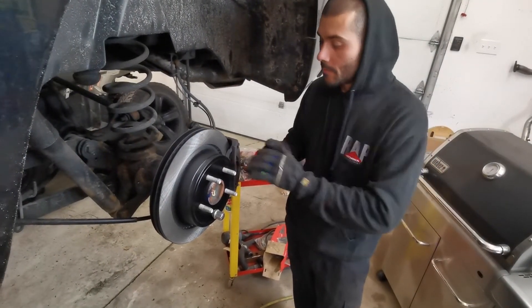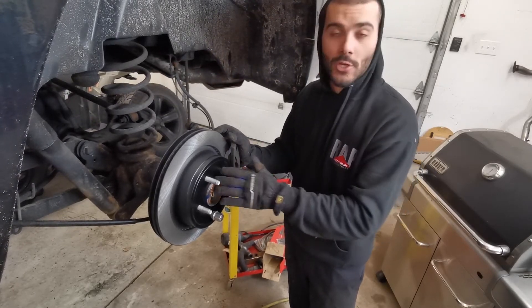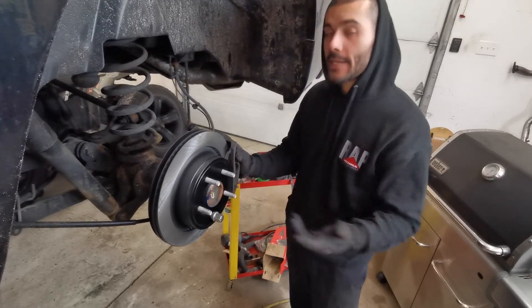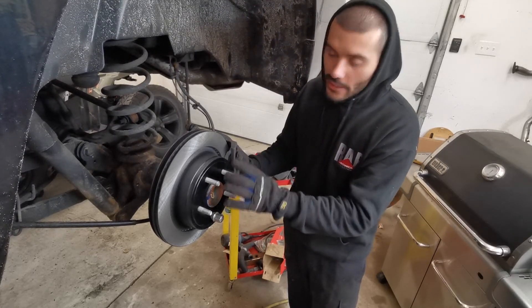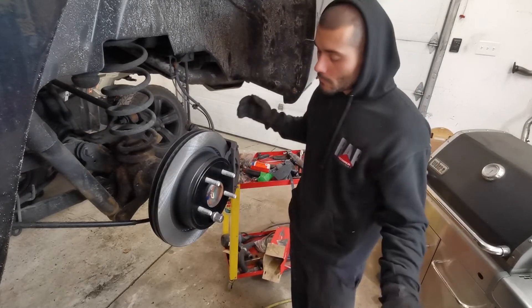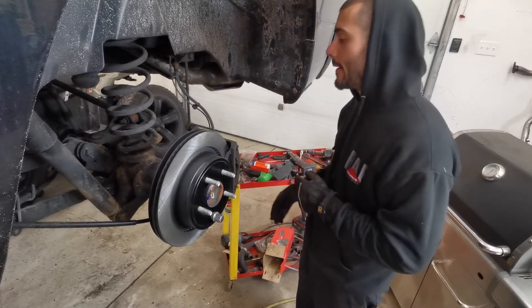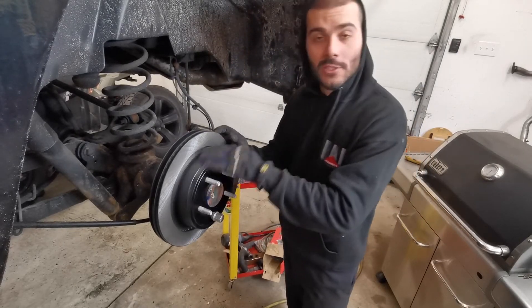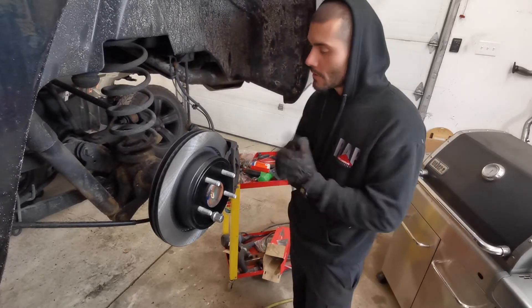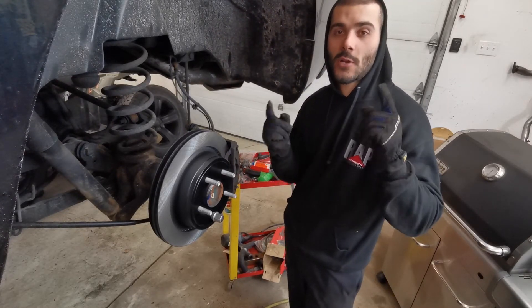That is pretty much it — straightforward. Like you saw, I had a hurdle with the rotor not coming off properly. If you don't have heat, what I recommend is soak it in penetrant and let it sit. Spray in the holes of the studs, let it creep down, and then give it some good hits. There's only one way and that's with force, unfortunately. Don't forget when you're done this, like every other brake job, pump your brake pedal. It's not much to it, guys — I hope you learned something. For the other side, same thing in reverse order. Remember on the other side, the caliper goes up first and then closes on the bottom — that's the only difference, but it's the same left to right. I hope you have the confidence to tackle this on your own. Don't forget to like, subscribe, and always full throttle.